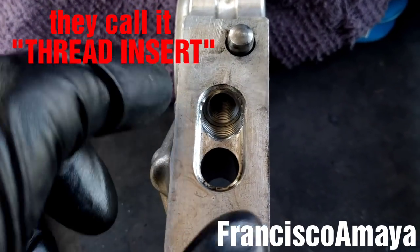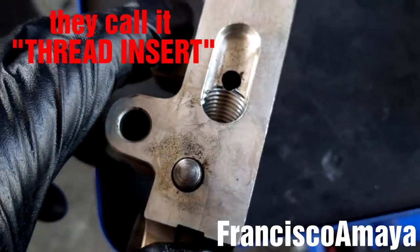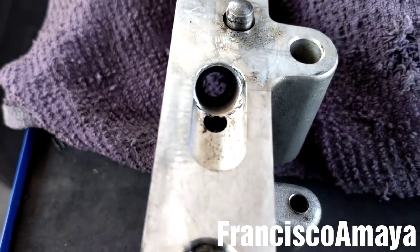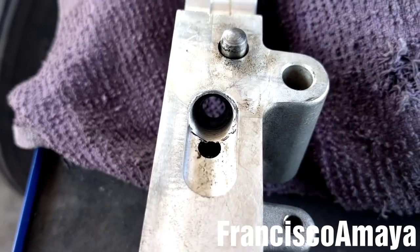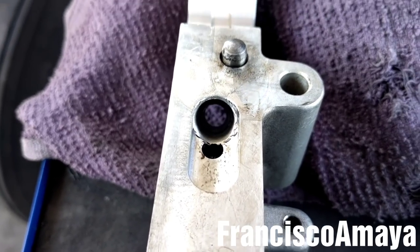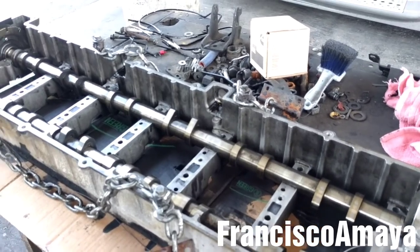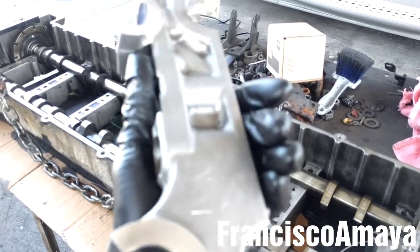which provides a higher torque than just a helicoil. The helicoil is the one that comes originally with the cam housing caps, and both of them are the same way. The other one is all the way in so it's really hard to see, but it's the same. If you replace the cam housing with a new one, it will come with helicoils on the cam housing caps.